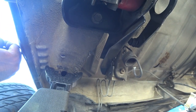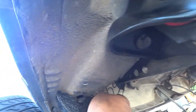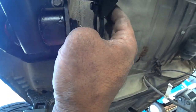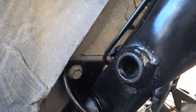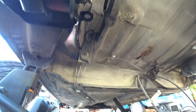I'm going to turn the camera off and back on in a minute. The spring goes around this little roller — remember that. Then the 13mm bolts go in by hand and you tighten them back down with your wrench. I'm going to tighten this down — these 13mm bolts right here. All of this has to be tightened down, and then last but not least the beam bolts — you're going to need to tighten those down as well: 1, 2, 3, same thing on the other side. That's all that's left — just the beam bolts and the bushing bolt.